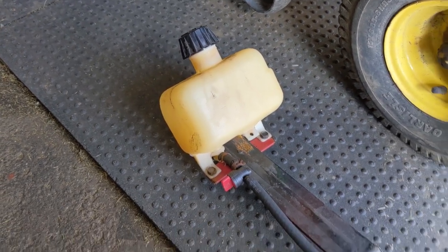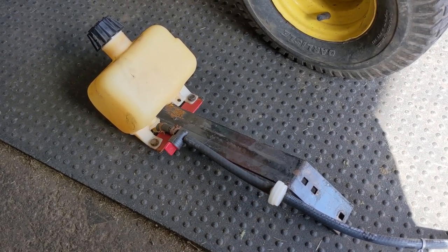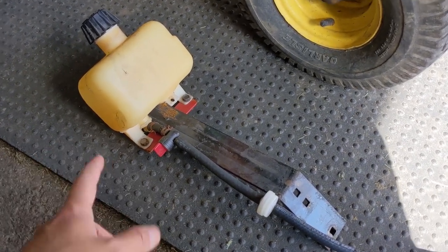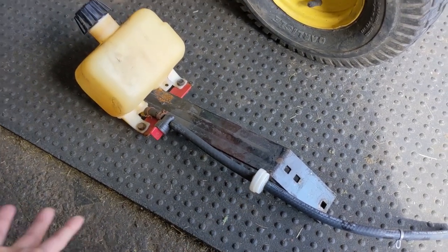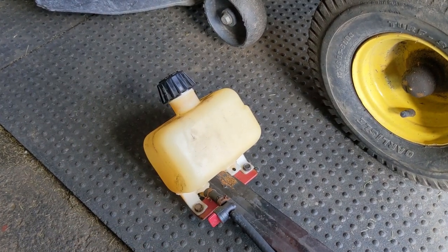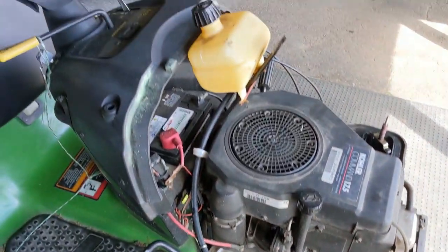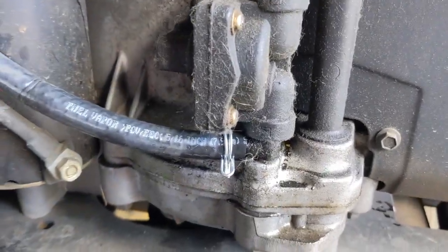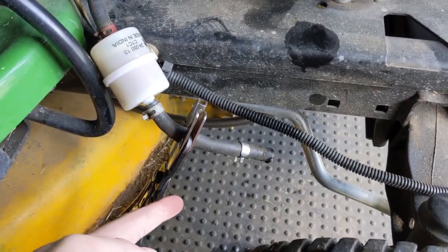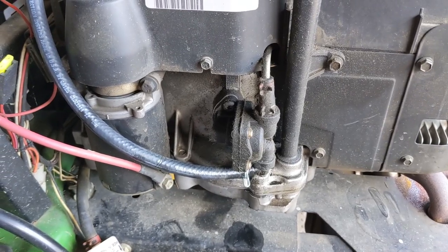I have a very small fuel tank bolted to a bracket — you've probably seen this on previous videos on my engine test stand. The benefits of having something like this is you can hook up a fuel shutoff valve with a fuel filter, and it has a long enough fuel line that I can hook it up wherever I want. We're isolating the customer's fuel by running our own fresh fuel that I know works. It doesn't have to be bolted up — you can prop it anywhere. I'll swap those lines over and get some fresh fuel into this small tank.